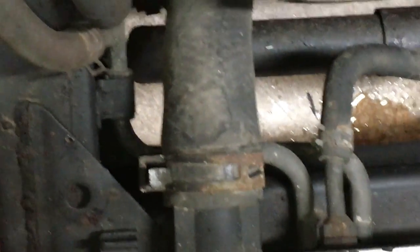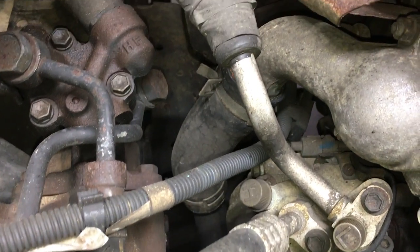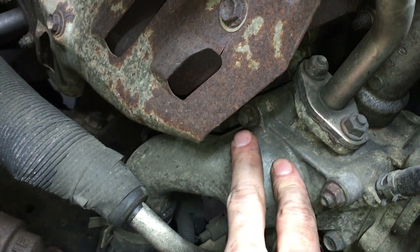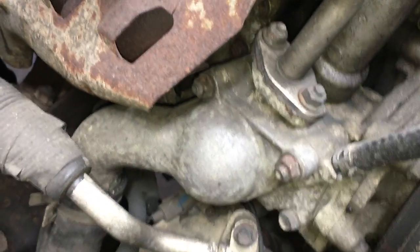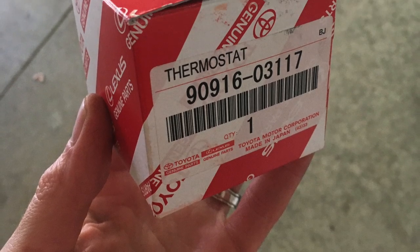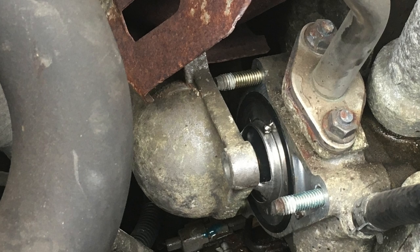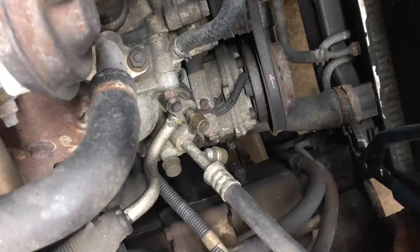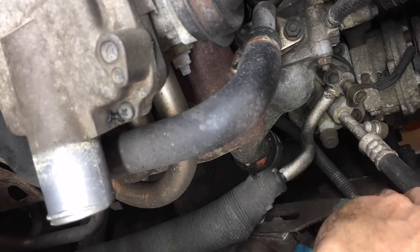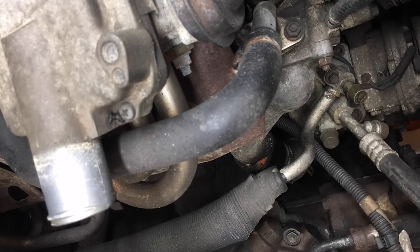This is radiator hose 3 and it runs back to that water pipe, which then goes to number 2 and then to the housing. I already replaced the thermostat less than a year ago, so I'm not going to take this off today. But normally this is the ideal time to replace the thermostat as well. Make sure to order the rubber gasket along with the OEM thermostat because it wasn't included. I'll have part numbers for those in the description. A little lube helped the clamp slide right down.